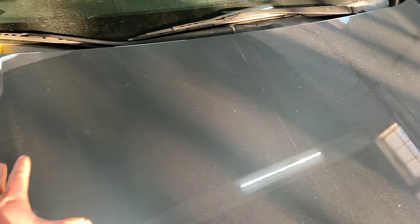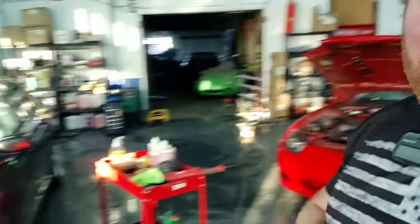Let's get back onto these LEDs. There's this side and there's this side — a lot less orange peel. I am not going to say this is the equivalent of wet sanding and buffing, because it is not. Does it remove orange peel? Yes. Will it remove 100% of orange peel? No. Will it remove like 70% to 80%? Yes. Is wet sanding and buffing the traditional method always going to be best? Yes. Is this a great alternative for a cheap used car or cheap little paint job like what we got here? Absolutely. And I will be doing this in the future.